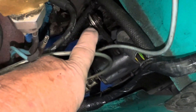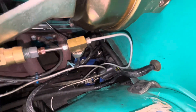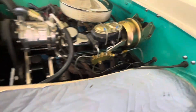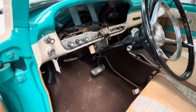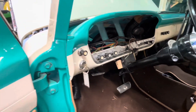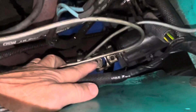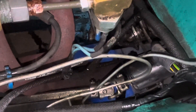It's right there. This column is going to have to come out through the bottom. Let me look at the inside — looks like there's some kind of a sleeve around it where it goes against the floor. I guess we'll start taking things loose under the dash, take the shift rod loose, and take this joint loose right there and see how it acts.